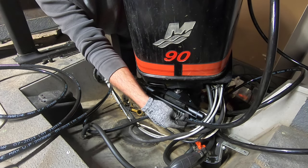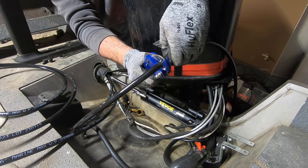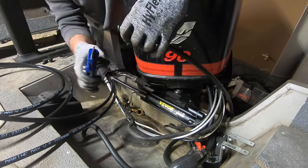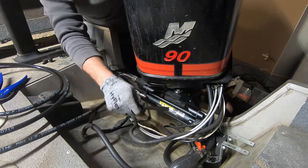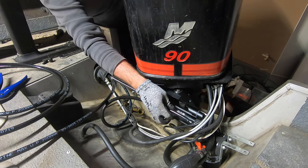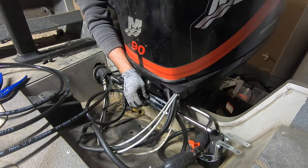So it's going to connect right there. I'm using a saw for this, because you don't want to get a bunch of debris in your hose, and that's tough stuff. That way I don't get my hoses confused. So now, if I'm turned all the way this way, you see I got some slack there. If you turn all the way this way, it still leaves room for it. It may be a little bit long, but I'm going to leave it like that for now, because like I said, I can always cut it back off and redo it.